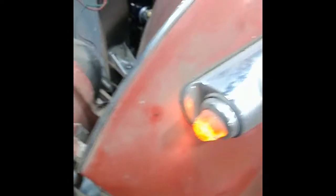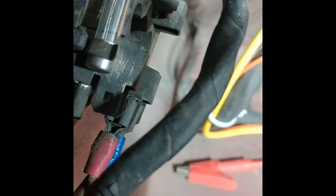That fixed up all my lights, at least the marker lights. This one's also out. I cleaned the top of that contact where the fuse is, but it didn't help. It was so dirty — I thought that was plastic down there, but it's actually the metal that the lugs go onto, so I sanded that and that fixed it up. I don't have high beams, just low beams, so I'll work on that next. That was easy — it was just a wire off the dipper switch, as they call it. I hooked that up and now I have high and low beams.